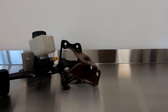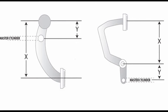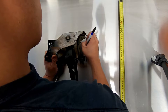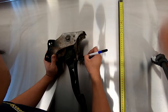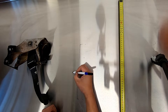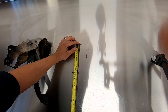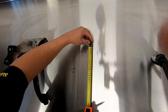The pedal ratio is the distance from the pedal pad to the pedal pivot point, divided by the distance of the master cylinder clevis pin or push rod from the pedal pivot point. Take your brake pedal and measure from the center of the pivot to the center of the brake pedal pad — call this measurement A. Then measure from the center of the pivot to the center of the original clevis pin hole — call this B. Divide A by B and that gives you a ratio to one. In the case of the Silvia it's 3.9 to 1.